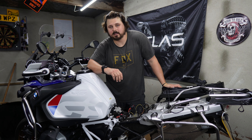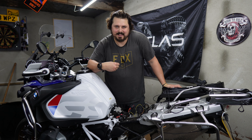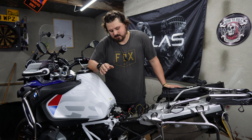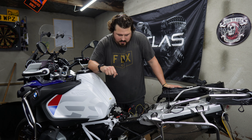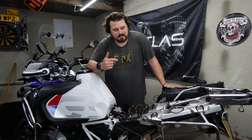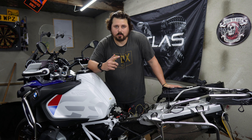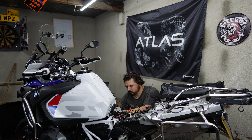And we are back. In the post these have arrived — the little T-connectors that are going to be used to connect power from the bike underneath the seat. I'm going to choose a cable that is live on the ignition and connect that to the accessory cable on the Vantrue unit. First thing to do is disconnect the bike battery — the battery on the GSA is on the right hand side of the bike, taking off a little cover, negative first and then positive.